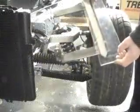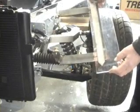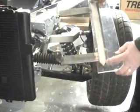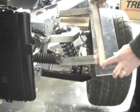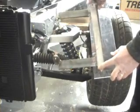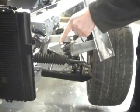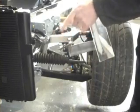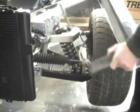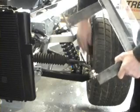This is a castor gauge that I made up. The pointer is 350mm long, so 6mm movement on the pointer is equivalent to 1 degree movement on the scale. On the bottom end, these two points are 70mm apart, representing 35mm actual offset between the middle of the top ball joint and the middle of the bottom ball joint.